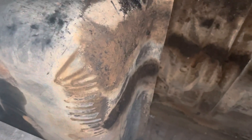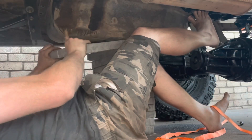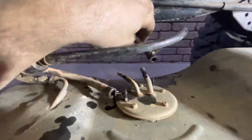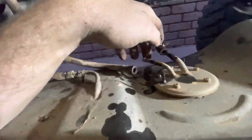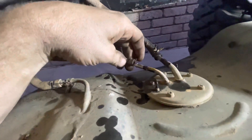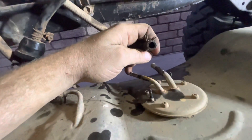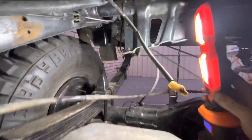Alright, do we think it's going to fall off? I don't think so. That should be it. I don't think you're gonna need photos to remember how this goes back together — the bigger diameter line is just going to stay connected with the tank as the overflow line. I've actually figured something out: the thinner one must be a return line and the other is the feed line. So the tank is out now.